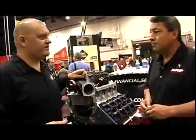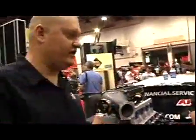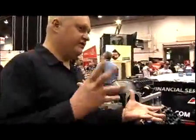From the first pull to the 10th pull to the 15th pull, ARP Ultra Torque stays within 5% of the desired clamp load you want to achieve. So if we set that up at 120 foot-pounds — we know that's going to make 18,000 pounds — it's going to do that within 5% every single pull. So if you're doing a line hone, every time you take the cap on and off, it's going to be right back to that perfectly round bore, since torquing distorts the block and cylinder head into their correct position.